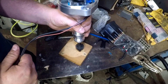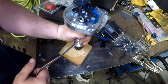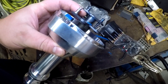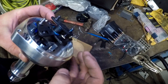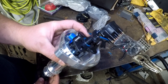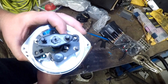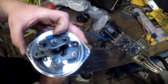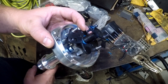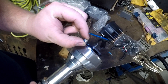I'm going to do it on the wood so I don't flatten or mushroom the end of my distributor — give it a good smack. What that did was unseat it: you can see this used to sit flat up against this collar, now the bottom's pushed up. You're going to take this and rotate it 180 degrees and drop that pin right back down in this hole. One side has a full slot — bigger hole — and this side's just got a small hole. Rotate 180 degrees and drop it right down in that hole, then reinstall.